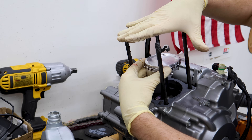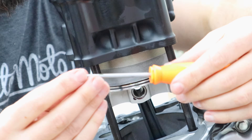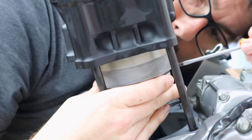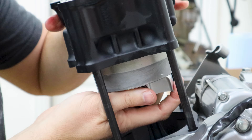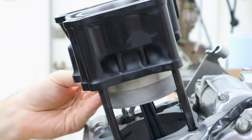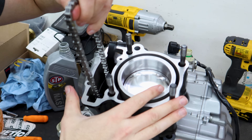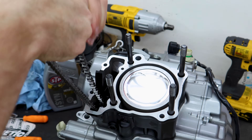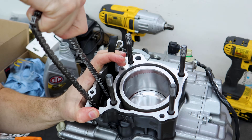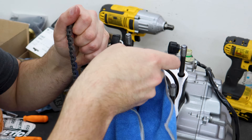The tricky part now is bringing the cylinder down while compressing the rings with my fingers as they slip in. You can carefully use a flat head screwdriver to press against the rings just a little to make sure they're sitting in their grooves — don't go sideways into them. I've got those rings in. Before sliding all the way down I grab the timing chain and pull it up through. There we go — all the way down. Applying a little pressure while spinning, we can feel everything seat properly.